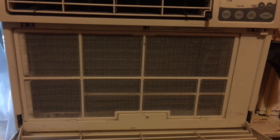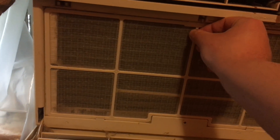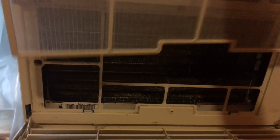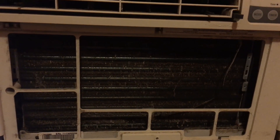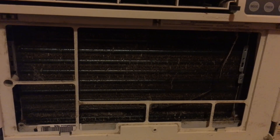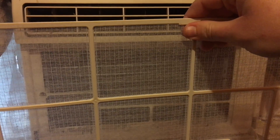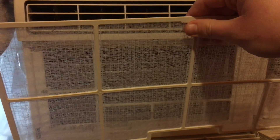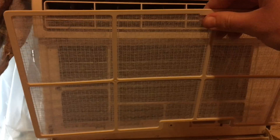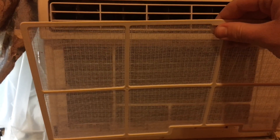Now it's time to maintain your air filter. Normally you want to take care of this every 10 to 15 days — it's really simple. This varies by model, but you have to find a way in to pull out your air filter. I know my evaporator's looking a little grimy — I may have to clean that as well. You'll take the air filter, run it under some water. Any big deposits like hairs and hairballs, you can wipe those off by hand before you take it to the sink. If it looks black or grimy, take some Dawn dish detergent, put it on each part of the filter, add some warm water, and rinse it out until it's nice and clean.